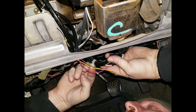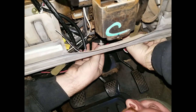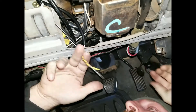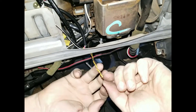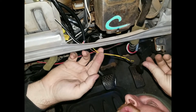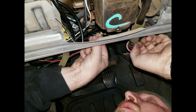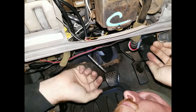Notice I didn't break the tab — we're going to stick it back up there so that it's nice and tight. These are your data logging wires. If I remember correctly, brown is wideband and yellow is narrowband — double check, but I'm pretty sure that's what they are. Unless you're data logging, you can just stick those to the side. For right now we're not data logging so we're just going to tuck them up. You can e-tape them or tuck them away from anything — whatever works.